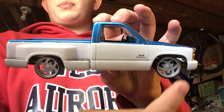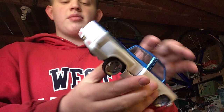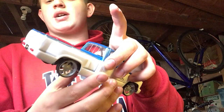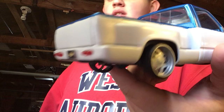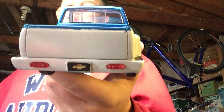All the trim going all the way around — literally everything was shaved, including the front bumper. The taillights are still in the truck, glued in place, but you can barely see them in the corners. I smoothed them over, removed the rear bumper, and made myself a custom fabricated roll pan out of plastic and putty. It turned out pretty good for my first time. I drilled out some holes, grafted in some taillight bezels, and glued in new taillights. The license plate is from my parts box and the plate decals are from the '77 Chevy van kit.